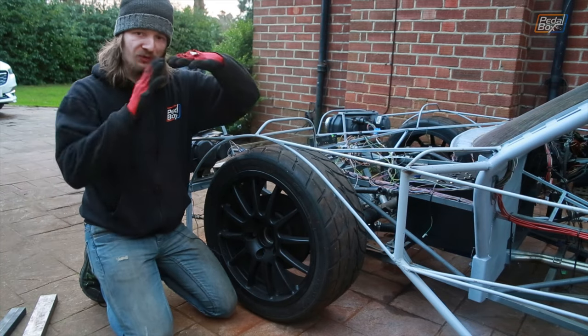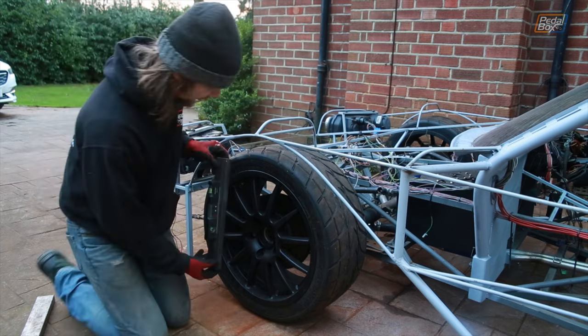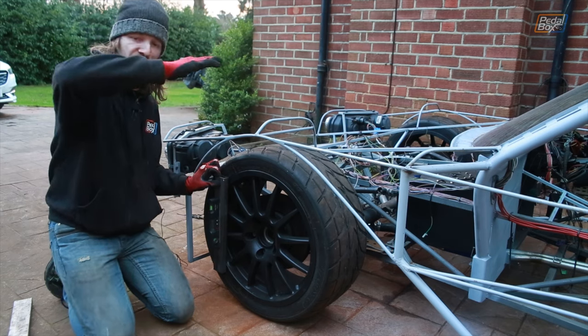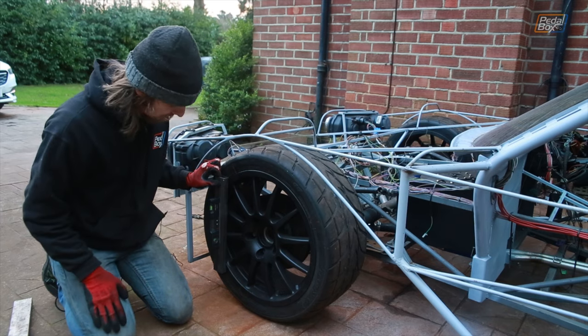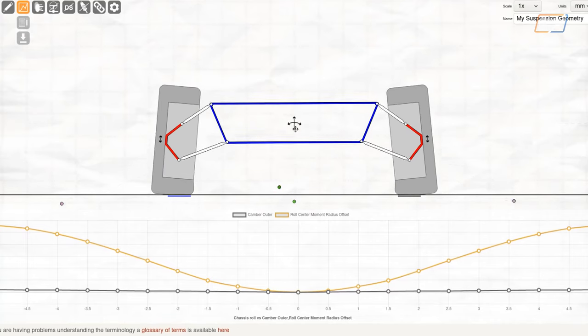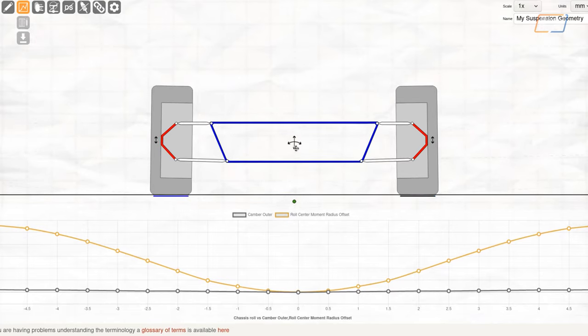Once you've got a level off your car so everything is zeroed out to the chassis properly, you can take your level, put it on something flat and straight, and place it down the edge of your wheel. Right now ours says 89.4 degrees, which means we're at 0.6 degrees of negative camber. With all of that entered, you hit apply at the bottom and it takes you to a fully built model ready to simulate. From here you can drag the chassis up and down to simulate going over crests and squashing down in compression — that'll show you how the suspension loads up and cambers. You can also roll it left and right to simulate the rolling forces during cornering and see your contact patches and camber behavior through all of that.